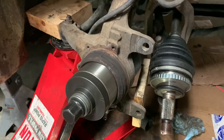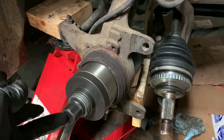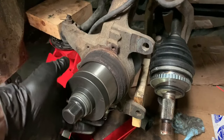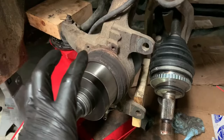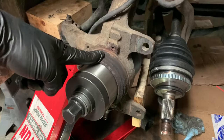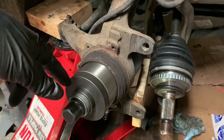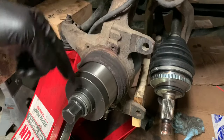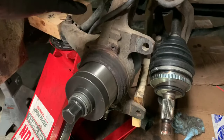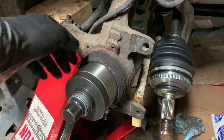On this one I just use my ratchet if I can — I might have to get my big breaker bar. I do not like using my air gun for this because you really want to be watching consistently the whole way around to make sure it's not going in at an angle, seating in straight. Once I see the bearing go all the way in, I'll back it out. Once it bottoms out, you stop — what could happen is you kind of squish part of the bearing past where it should go. Slow and steady wins this race.